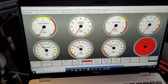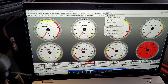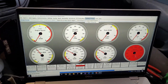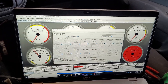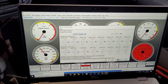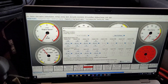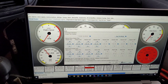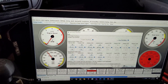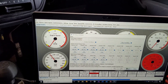I'll show you how you do that with the Speeduino setup in Tuner Studio, which looks very similar to what you'd get with Mega Squirt. Go to Hardware Testing, then Test Output Hardware, then Enable Test Mode. From there you can turn on the coil outputs and give them a 50% duty cycle.